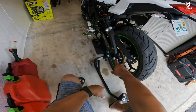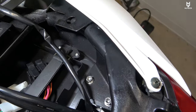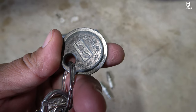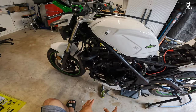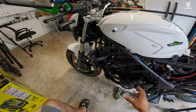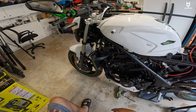I went ahead and right off the bat replaced the chain. This fender delete came from a Kawasaki Ninja from 2013 all the way to 2017 — it fits right on, no issues whatsoever, no cutting, no nothing. It fits like it was made for it. I did replace the spark plugs — these are the NGK Iridium 7803, gapped to 0.025. That's the recommendation, and it tells you right here on this tag what the gap needs to be. The last thing I want to do here is replace these coils. The bike is kind of stuttering a little bit, especially when you are on fifth gear and the engine is a little more relaxed — you can feel it pushing you. That's why I tried the spark plugs, but that didn't work. So I'm going to get different ignition coils for both sides, test them out, and hopefully that'll make things a little better.